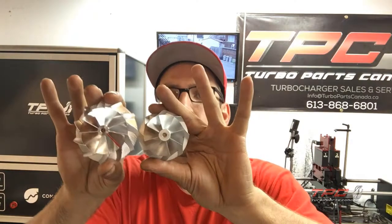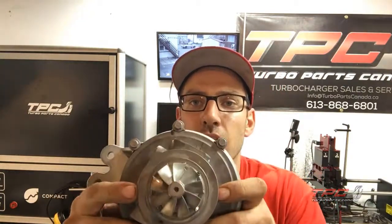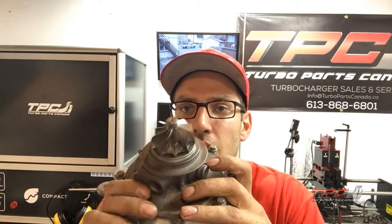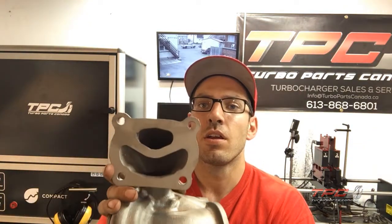You get a longer power band and a bigger punch. We swapped these out, machined the housings — we could put a bigger wheel in there, but I think this is the biggest wheel that turbine can support. It's a nice design turbine, so I don't feel like we should have to clip these. It's a new design, nice wide open.